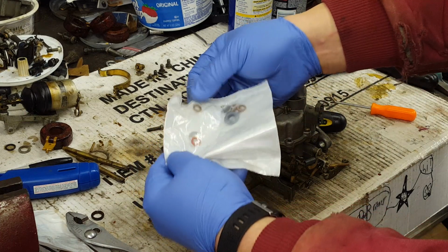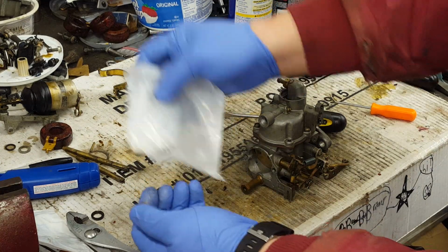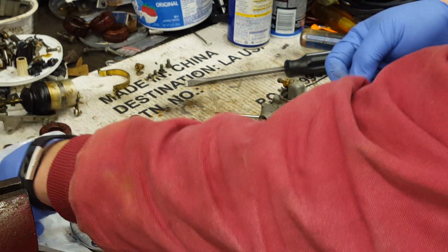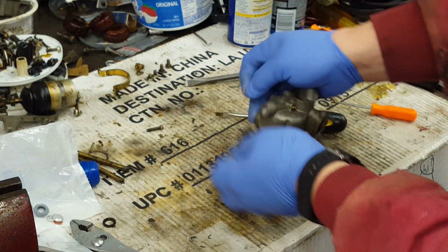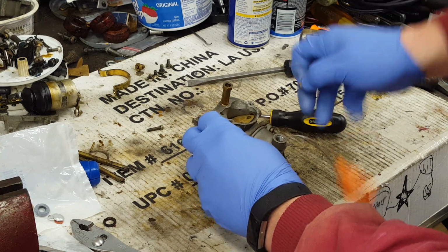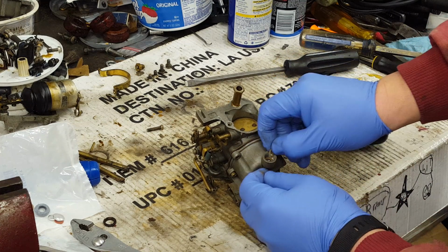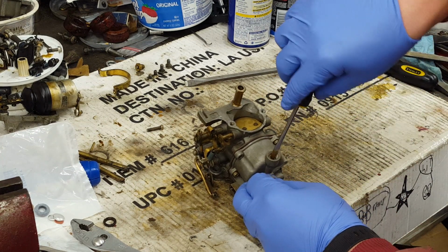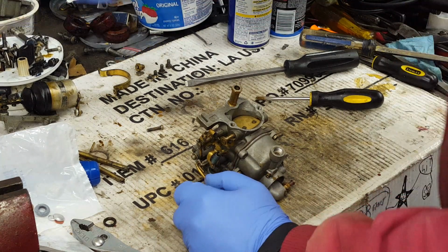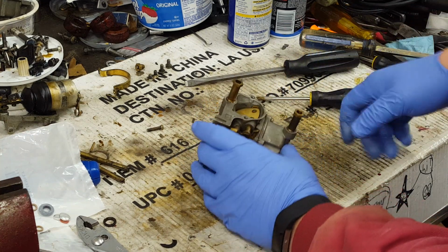Before we attach that, let's get our other packing washers out. Just empty everything here and I'll put the other stuff back when I'm done. 2 packing washers and the plastic one. Set that first packing washer in. Oops. That's nice and flat. Second one. That's nice and flat. And then that plastic one on top. We get our other packing nut, sorry. And snug that one up.